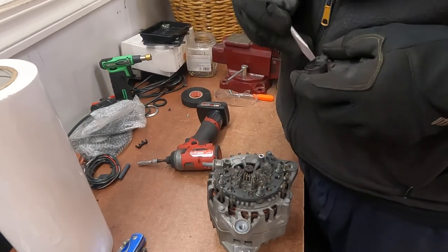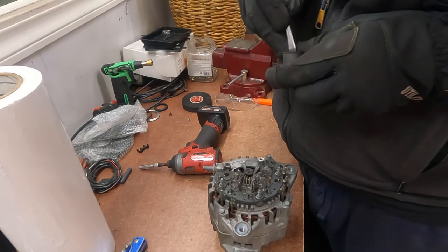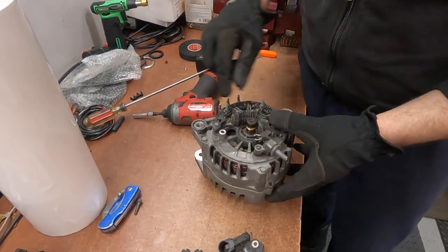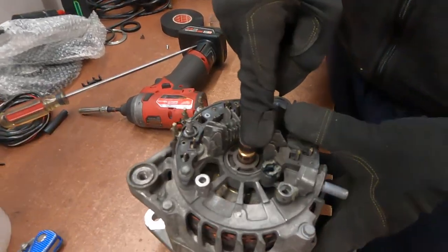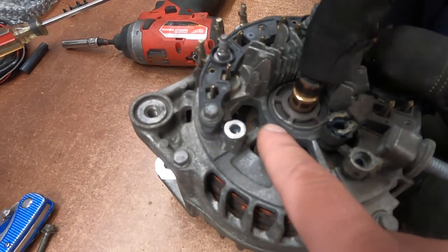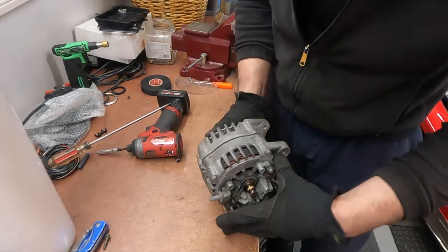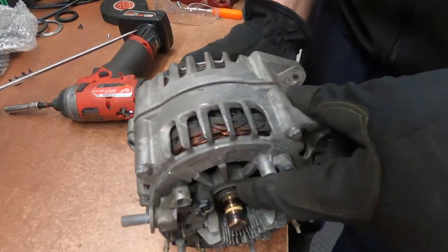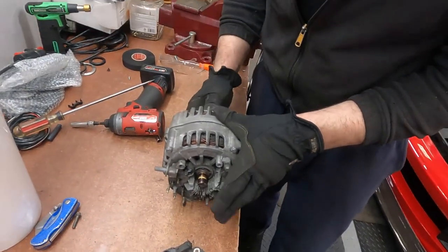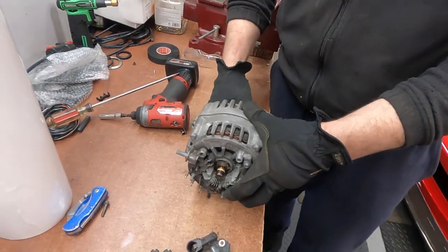I will show you guys. I need a smaller one, but you can see the movement. See the shaft movement. That plastic cup bearing, you see how it moved. And at higher speed, you can see these two different colors. This is normal, and that one didn't touch. And at high RPM, that shaft just moves and hits the brushes.